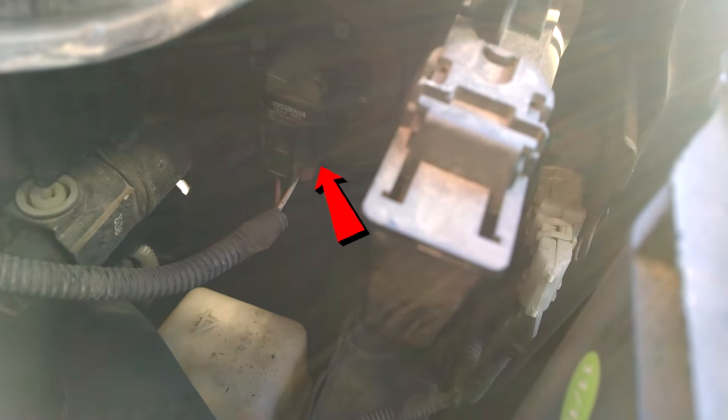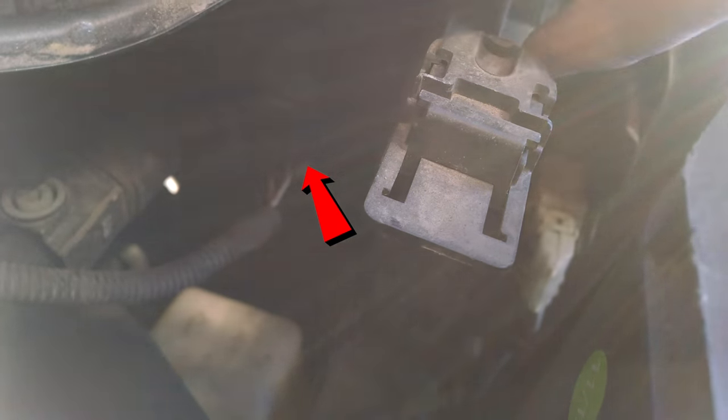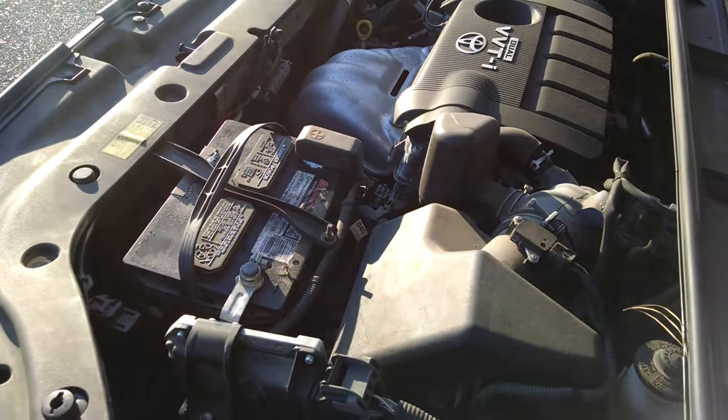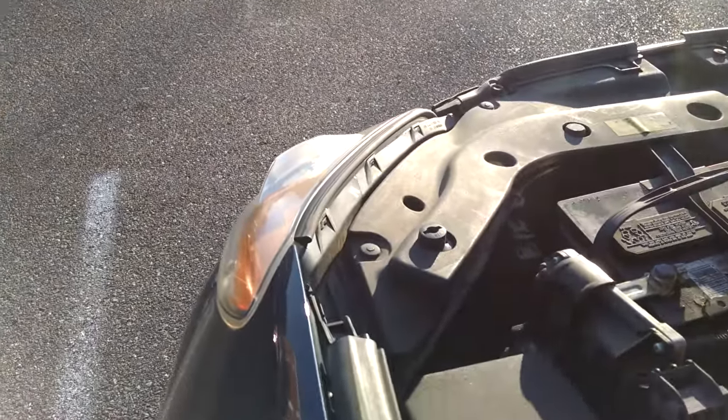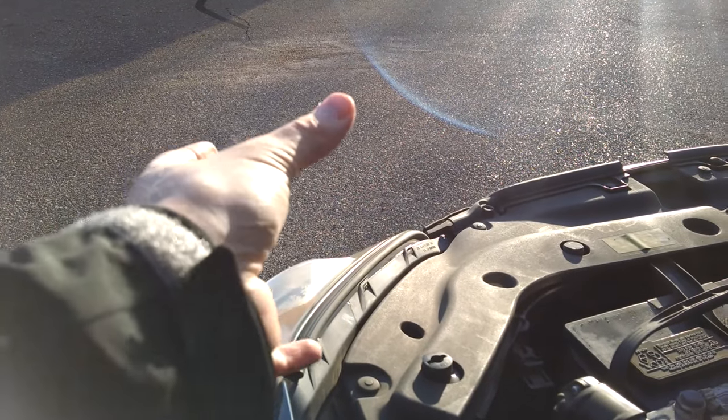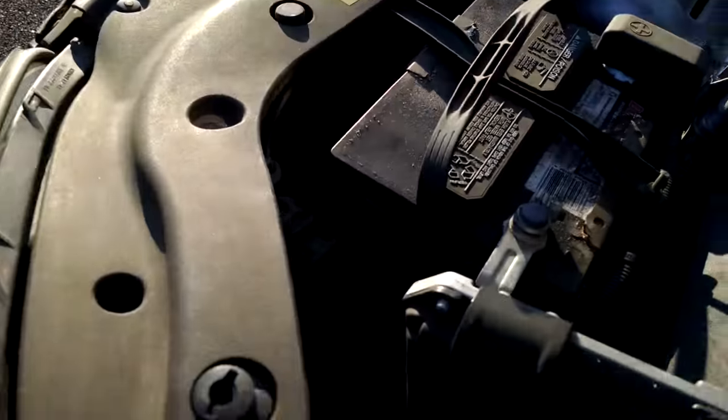On the back side there is — there we go, we can see it. Right here you can see this black cable leading to the back of the headlight. All we need to do is twist that counterclockwise. Think of counterclockwise this way: if you're facing towards the front of the car, think of a clock face — you want to twist it this way. So get your hand in there.